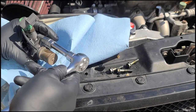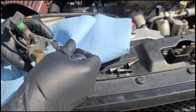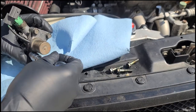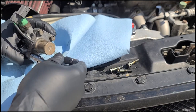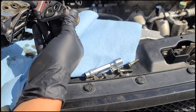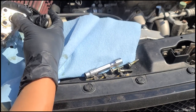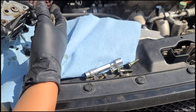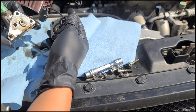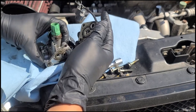While loosening the top three bolts I noticed they were super loose — literally almost finger loose. So this is where I think the leak is actually coming from. You can see the large amount of oil that released from removing that top part. There's a lot of pressure coming out of that spot, but I'm going to change the gasket anyway since I have no idea how old it is.